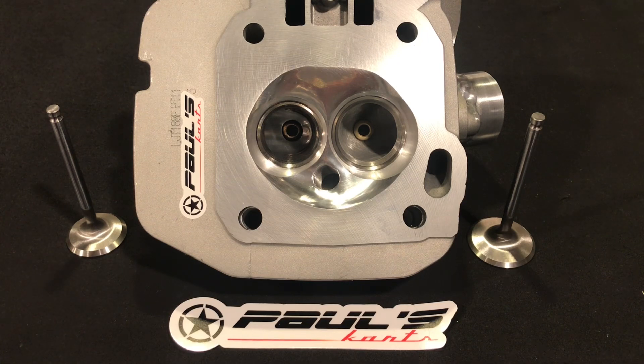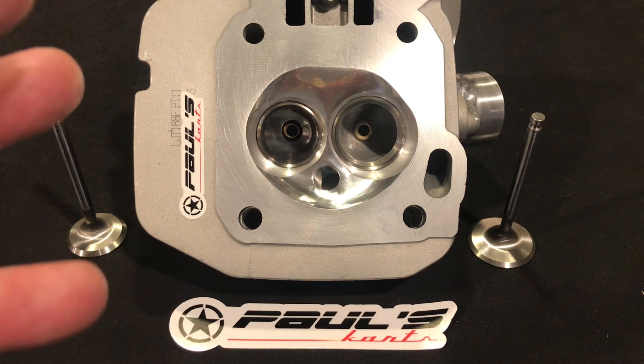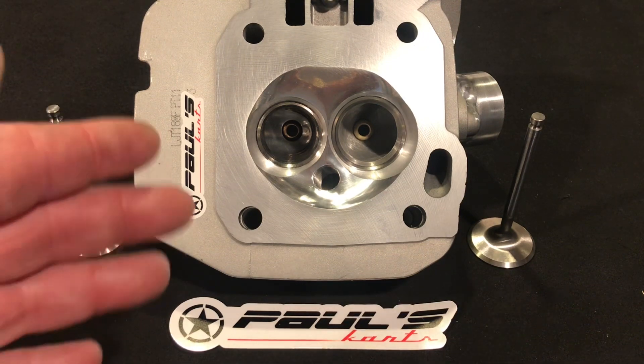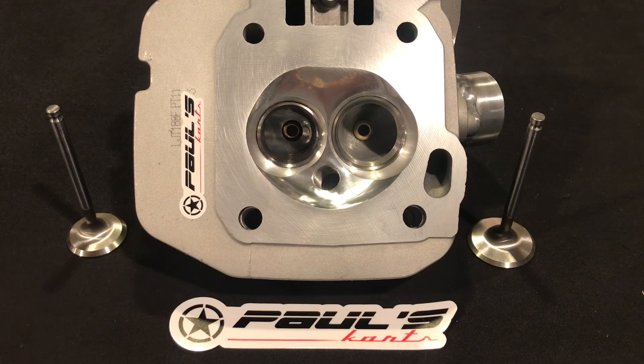We got bronze guides in this head. Bronze guides are always great for the lubricity factor and the way they interact with the stem. You want to keep 1.2 thousandths between the stem and the guide — that's the minimum distance of three oil globules. Having a bronze guide rubbing on the valve is much better than steel because of the lubricity factor bronze guides have. When you guys get your cylinder heads, you definitely want to always lap your valves. We'll always send a little bag with the valves with a note on how to lap your valves and tips on getting a good seal.